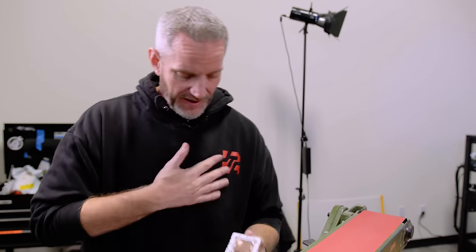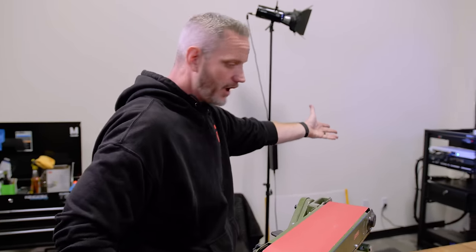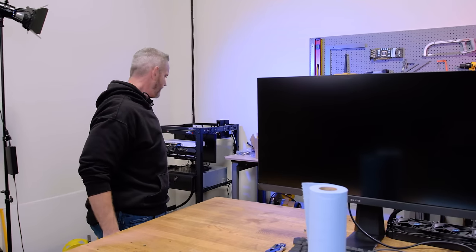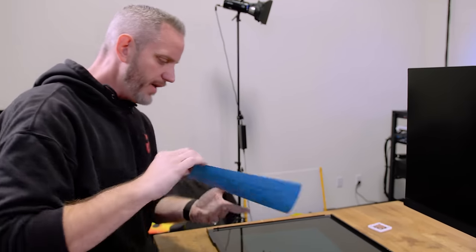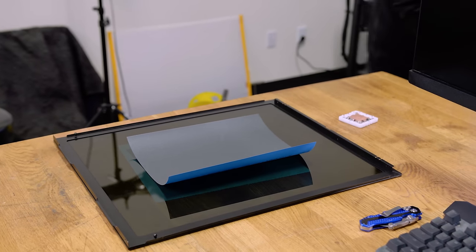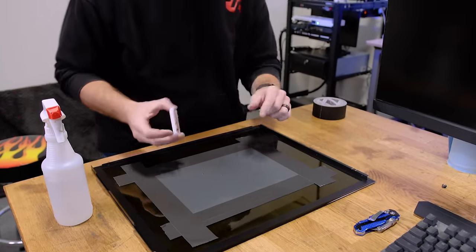I took a lot of material off and it gets very hot - not as hot as it would in the system, but hot all the way through the back. Fortunately I didn't send it flying into our server. I'm going to use the sandpaper he sent with the package and a piece of tempered glass to get the flatness back. I'll be able to apply pressure more lightly. I just take a spare side panel from a case, tape it down to the glass - which is perfectly flat - and use wet-dry sandpaper with a little bit of distilled water to keep it from clogging.